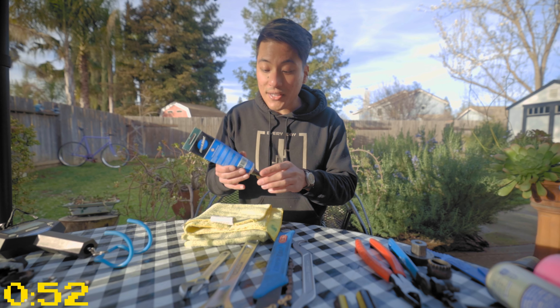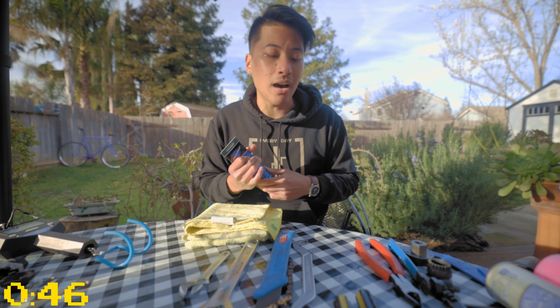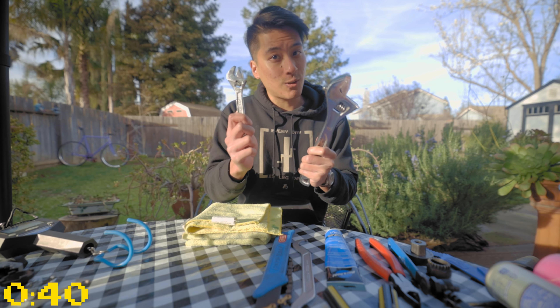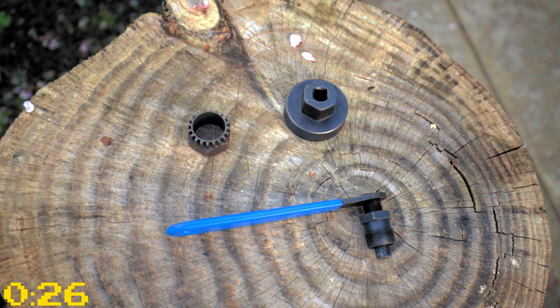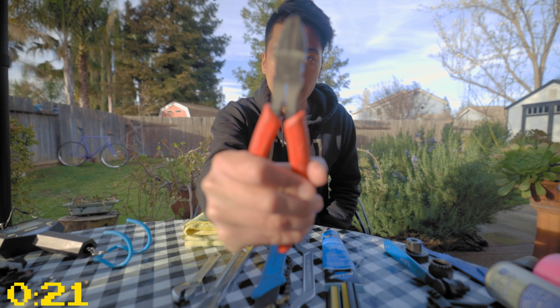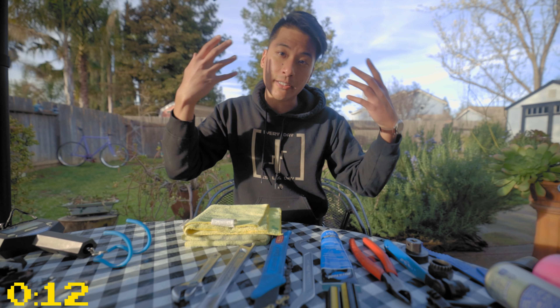For pretty much anything that has threads on your bike, and even some components that don't, you're going to need to grease it so that it doesn't seize up. A flathead and Phillips screwdriver come in handy, as do a big crescent wrench and a little crescent wrench. Most fixed gear and single speed bikes come with square taper cranks, which need a crank puller to take them off. Get the appropriate bottom bracket tool for what's on your bike. If you ever decide to run brakes, you'll need cable cutters. And a metric tape measure comes in handy if you want to figure out your ideal fit.